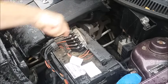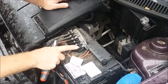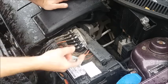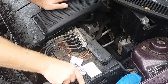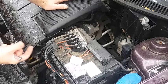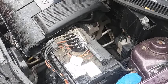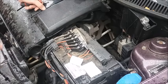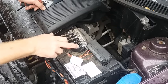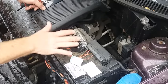Hand tight — no need to do them excessively tight. Now if this happens to you and you're not able to get to a shop that sells this kind of fuse, or maybe you're away from home, you could use a piece of domestic fuse wire. If you go to any hardware store or DIY place you can buy fuse wire — the same sort that you would use in a fuse board in older electrical installations at home, usually 30 amp fuse wire. You could wrap it from one terminal to another. But I would suggest that you do not use an ordinary piece of copper wire or a nail or anything like that, because then you've got no fuse protection on the outgoing circuits, and if there is an electrical problem that could be dangerous.